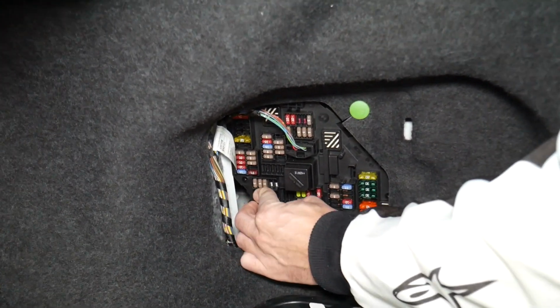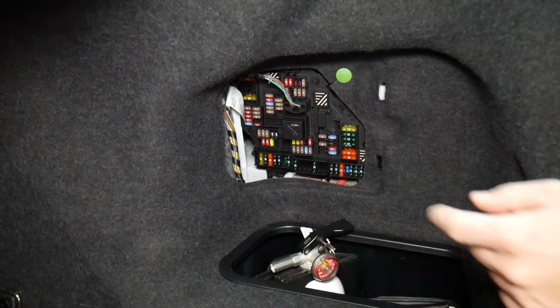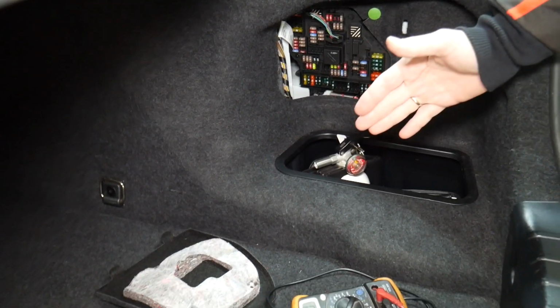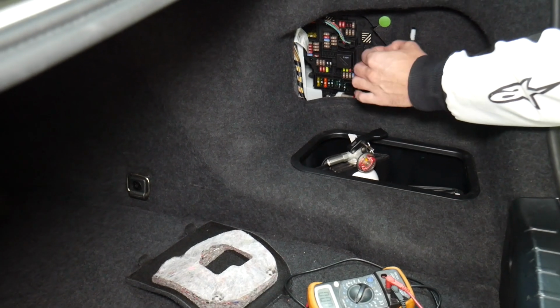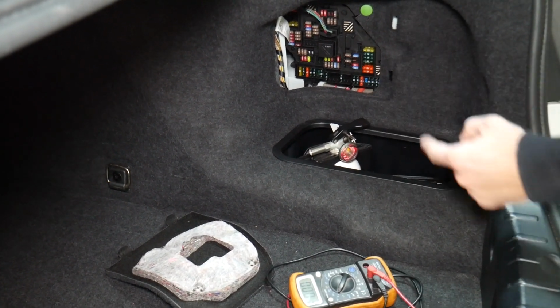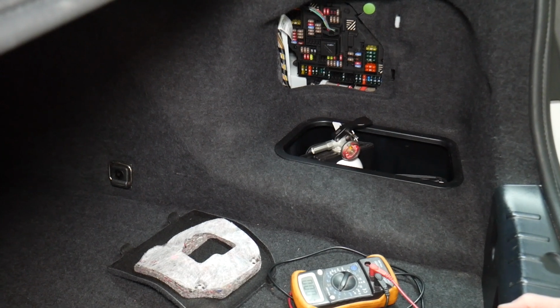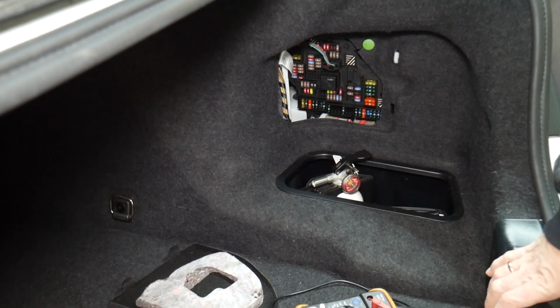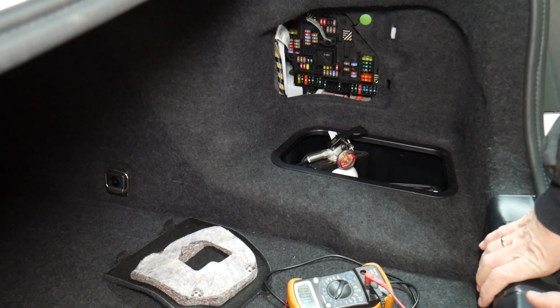Another thing, always test your relays. They're a little bit harder to test, but if you want to see, guys, how to test fuse relays, we will put a link in the description of the video below. But we've seen so many customers that think that they have a good fuse, they put it back in, they waste their money on parts and diagnostics that they practically do not need. So check out the link in the description of the video below, how to test the fuse and how to test the relay as well.